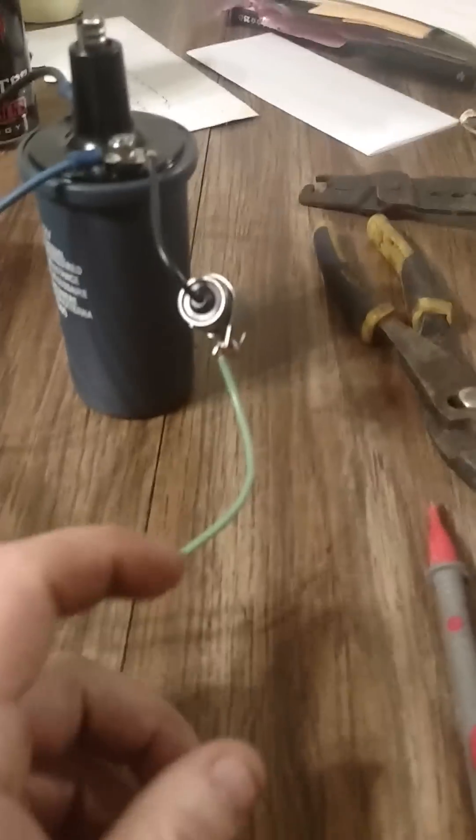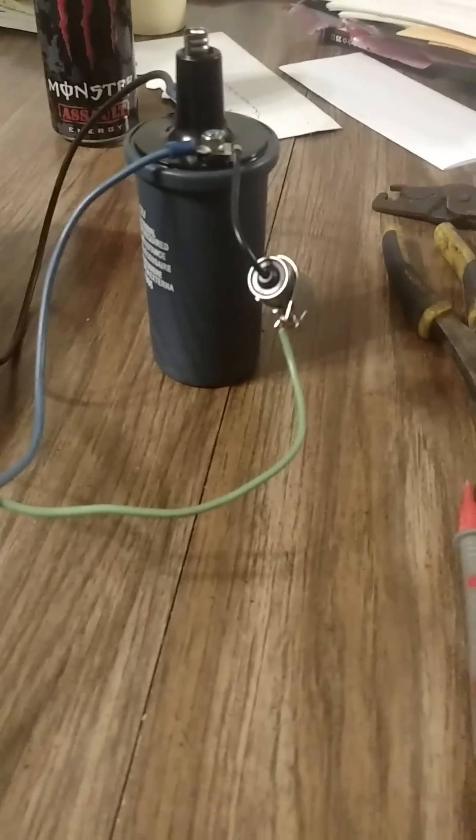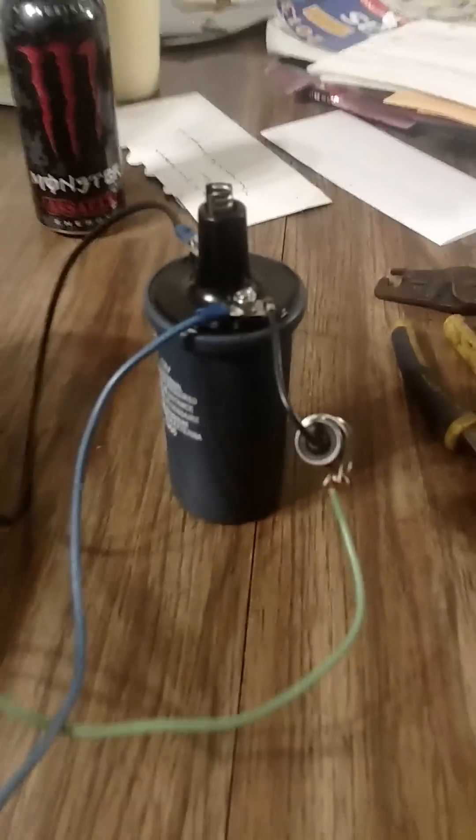You can see the way I have this wired up — I have the condenser grounded. We have the flasher relay grounded, and right there on X we have L for load, running back to the negative side of the ignition coil. And then on the positive side of the ignition coil we have power.